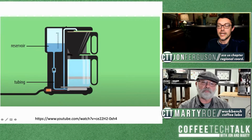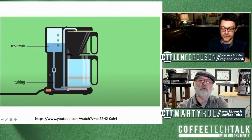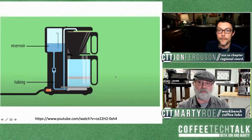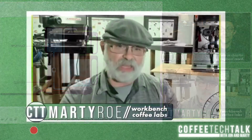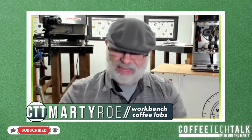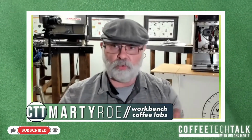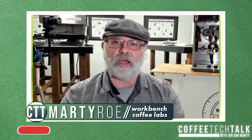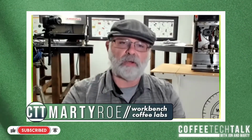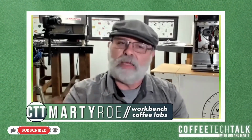Sure. So is that all that's going on there? With the heating element down there, what does that exactly do, and how does it know that it's going to stop at 205 degrees or whatever? Well, here's kind of my take on it. This is your quintessential Mr. Coffee type brewing device. And I know a lot of people in the coffee industry go, oh, Mr. Coffee, that's not very good. This is the exact same design that the SCA certified brewers use. They've just done a better job of the magic between the heating element and where it comes out over the coffee. They've designed it so that temperature is more constant than your average Mr. Coffee. But the process is the same.